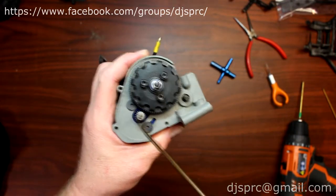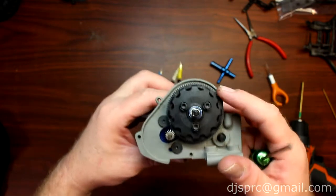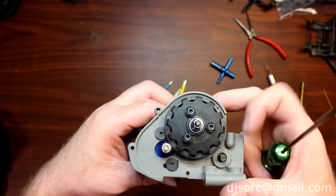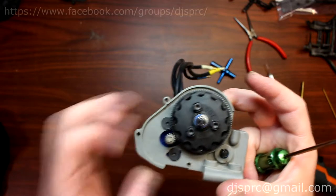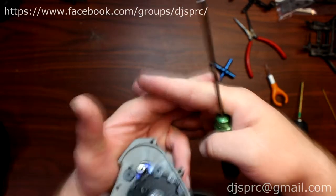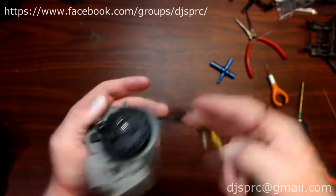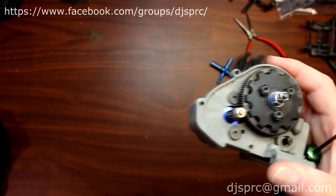Basically what I do: I bolt my motor back in loosened, make sure both screws are loosened, and put them tight together. Now you can see they're physically tight — this is not the way you want it. If you keep it tight like this, this plastic when you're driving will flex. It seems to be hard plastic but it does flex, and both gears are going to become tighter together — that's where the damage will be created. If you back it off a bit you can see they're still touching, but sometimes when I turn it, it skips.